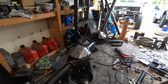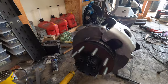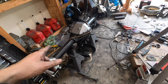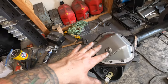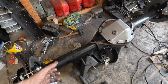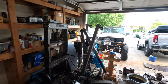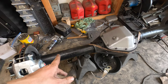After hours and hours of dirty work — grinding, painting, torquing — we finally have this thing all done. I don't have the axle shafts bolted in yet because I'm going to put some gray RTV on there, the high-torque one, seal it in, and then do the RTV around here with the black, oil-resistant one. I'm going to wait on filling it up with oil because we still have a few little things to do, like the perches. I'm going to order some U-bolt eliminator perches from Rough Stuff — they just have four bolts that bolt to the top. I'm not sure where those are going to go yet. I could measure the rear spring width of the Samurai and weld them on, but then there's the pinion angle and everything. We're just going to wait, but this thing's pretty much ready to go.